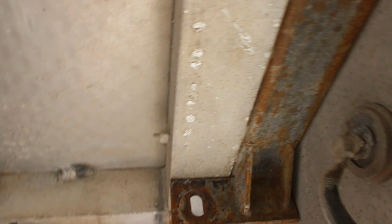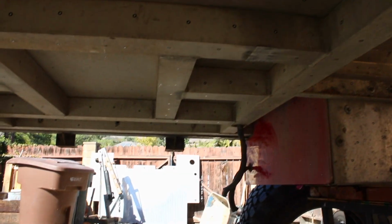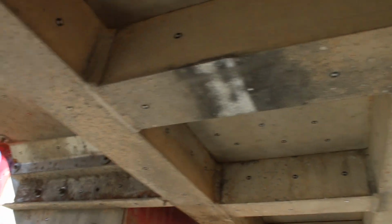mounted to aluminum. And on the front, they put a thin insulator in between, whatever you want to call it, to try and mitigate that galvanic corrosion. But we'll see. I might throw something thicker, but yeah, I'm going to thicken up these bolts for sure. I think I am going to reuse this mounting strategy, the back and front. I might throw one more in the middle, but figure out a way to cover the frame with something so it's not aluminum sitting right on steel.